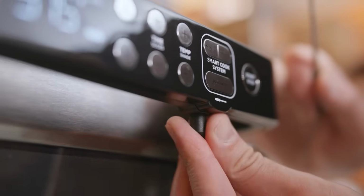And this gets at the question of what trade-offs Ninja has had to make to be able to sell this oven profitably at a significantly lower price than the other 2 ovens we've looked at. If you look closely at the build of this oven and the many design and engineering decisions, you can see numerous cost-cutting measures. Putting the jack for the thermometer outside the oven avoids routing electronics from inside the oven to the control board in the handle. It also avoids a high-temperature connector.